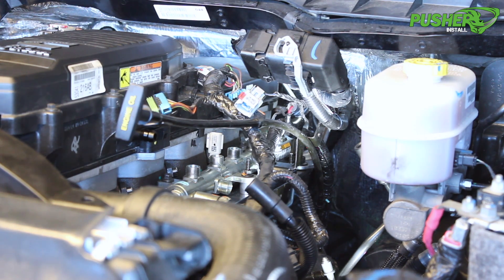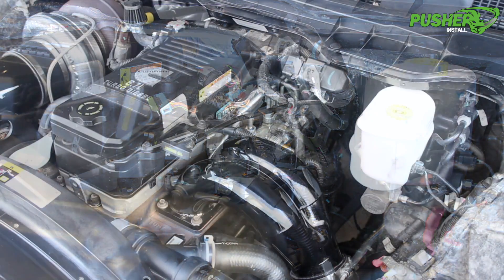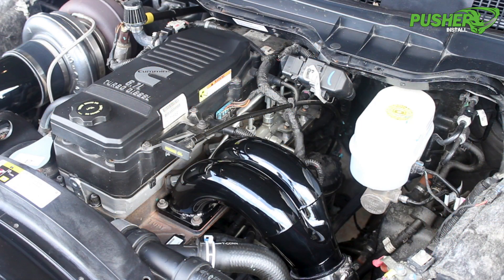Speaking of which, we're going to go ahead and install those injector lines after we torque the rail down. So you can see that we've gone ahead and reinstalled all of our factory fuel lines in the reverse order they came off. Having them laid out on that cart the way I talked about really helps this reinstallation go smoothly. All of our wiring harness is hooked up. Everything is hooked up that we took off regarding the heater grid delete. You can see that I've gone ahead and installed our three and a half inch mega intake manifold instead of putting the factory one back on. This manifold is good for right at 50% more flow than the factory one. So it's a really nice thing to match up with the heater grid delete. Also you can barely just see I put in our three and a half inch driver side charge tube there as well. That's also a great thing to pair up with this whole setup. It really improves the whole flow path of the whole driver side of the charge system.